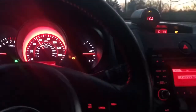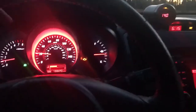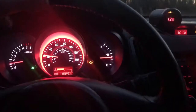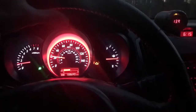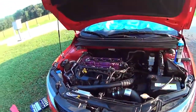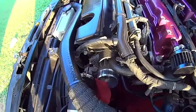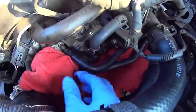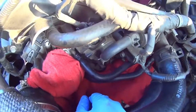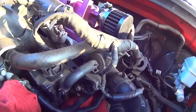Here's the how-to video. It is kind of spliced together because I edited out some of what I said back then since I didn't really know what was going to happen. This is how to do a throttle body coolant bypass on a 2010 Kia Forte. I've already detached the intake just to give a little more room. There's a coolant hose here and one below it going to the throttle body, attaching farther back down.